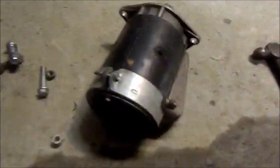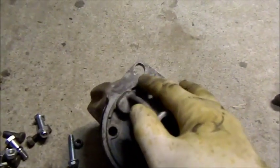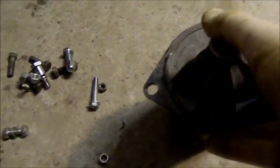I thought they changed in 1970 with the Cleveland, but who knows, it's a long time ago now. I'm using this Clapper starter motor. This isn't a very old one at all. In fact, it's got manufacturing stickers and all sorts of stuff on it, but the problem is it clashed with the other ring gear, in that some clown has actually filed these holes out to fit on the 157 tooth starter.